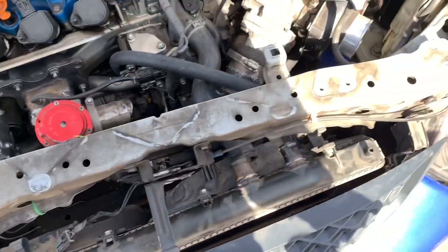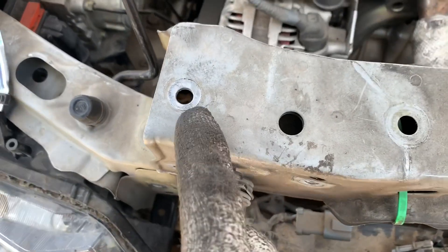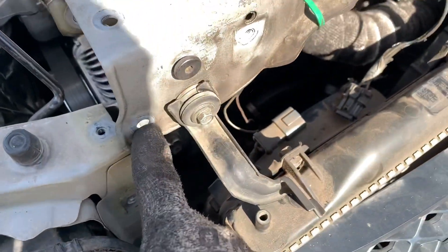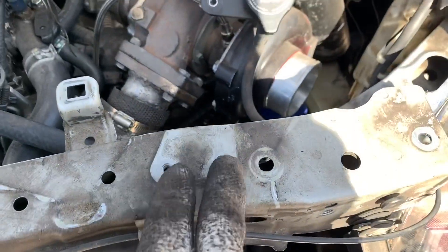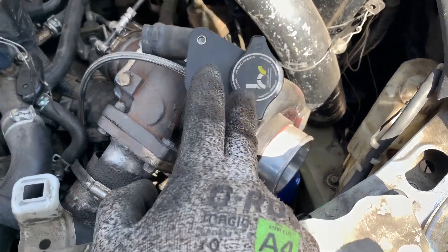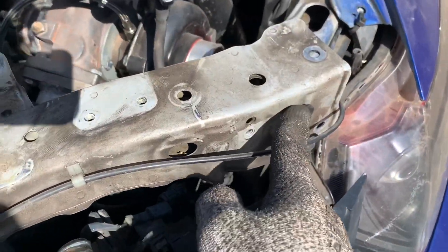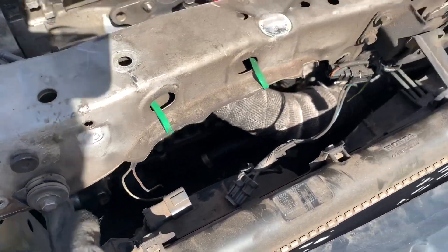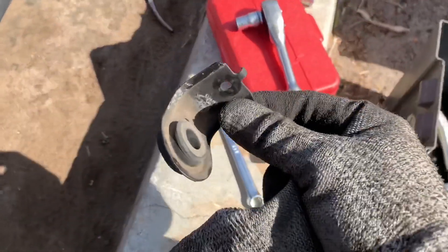Alright guys, it's a bit of a mess — I'm just kind of fast forwarding. So there are going to be 6 bolts: one on the top, one on the back, one on the front, same on this side — one here, one here, one in the back. You will also have to undo your reservoir nozzle thing right here. If you have your bumper, you're going to have to undo those right there. I don't have an AC condenser so I took that off, but you might want to remove those — these, these, and also these right here because those are your radiator brackets.